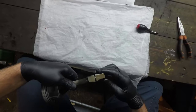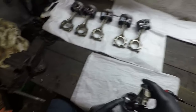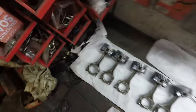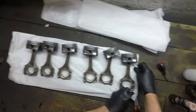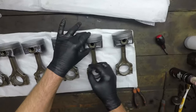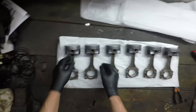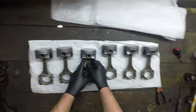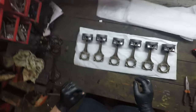That is them all done. I'm matching up the number stamps on either side of the piston crown as I put these together. There you are folks — one well-chuffed Scotsman. We've got six pistons — apart from the rings, I'm not going to put those in yet, I'll leave that to the last minute — assembled, cleaned, and ready to go. I'm going to wrap these up nice and carefully, call it a day at the garage today, and get off to work. Thanks for watching guys.